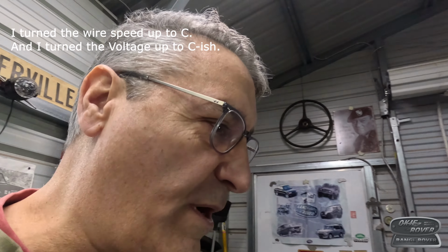That'll work. Okay, we're back in the shop again today. It's a Saturday. We're going to get this C-pillar piece welded up today. That is the plan. I thought about it and watched some videos about how to weld upside down. All of them were structural, like welding quarter inch stuff, where you have plenty of time to do your zigzag. You can't do that with sheet metal. You've got to get it done. The only tip I got out of there, and the only one I'll probably use, is to turn up my heat and turn up my wire speed. I'm definitely going to attempt that.